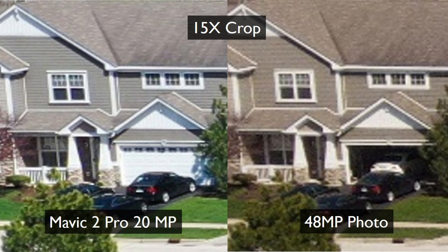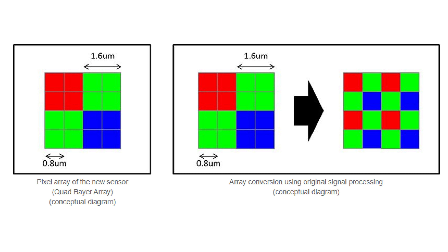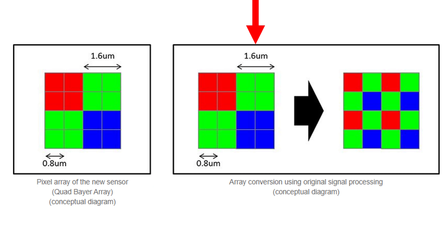The backdrop of all this is the Sony IMX586 sensor. They took every pixel and cut it into four pieces. So when you're shooting in 12 megapixels, all four pieces together capture all that light — it's going to behave like each pixel is 1.6 microns. In contrast, when you shoot in 48 megapixels, it's split in half, so you're using only a 0.8 micron. And since this is a square, that means it's getting one-fourth of the light. The results indicate that.